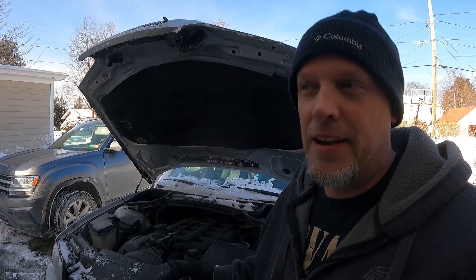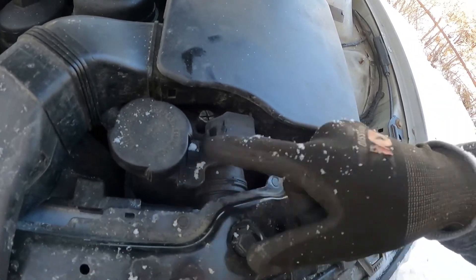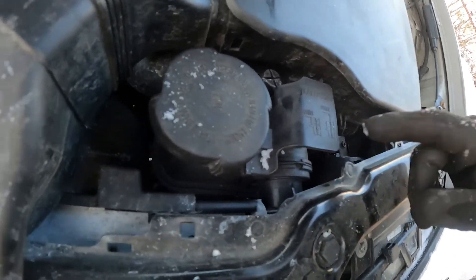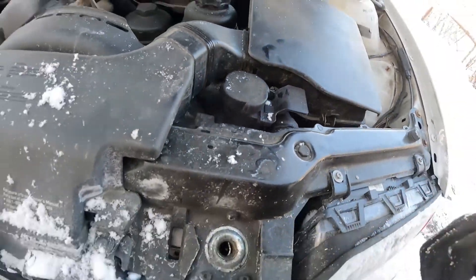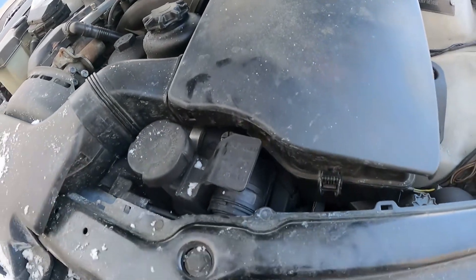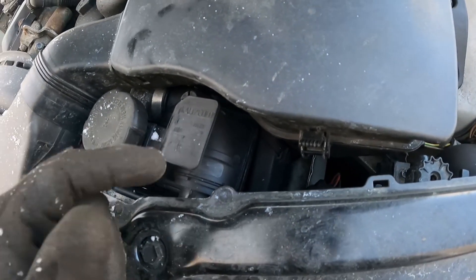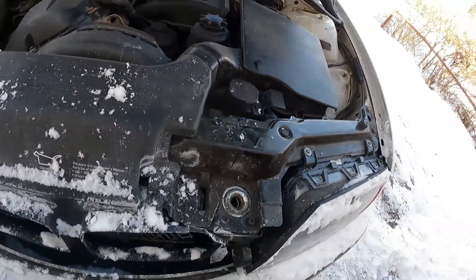You know you want to see this thing fail — just subscribe. I'm having to add about a quarter of a gallon of coolant every two days. When I bought this car it had a new radiator, a new overflow tank, and all the plastic in the area of the radiator had been replaced. That was about two and a half years ago. It's very common for the overflow tank to crack, but that's not what's going on here — my leak is actually coming from these two O-rings.